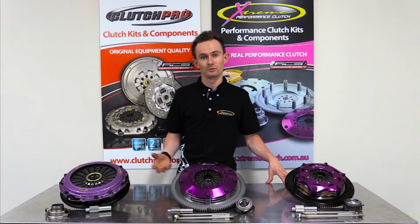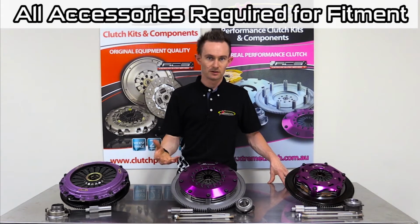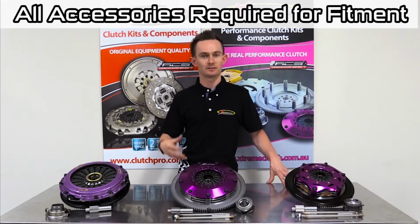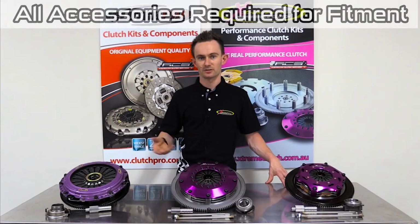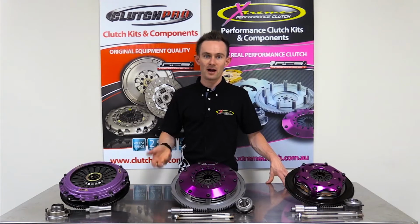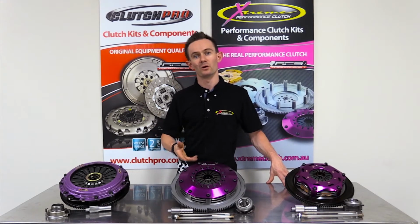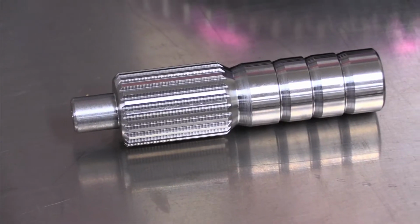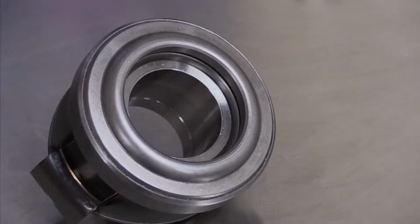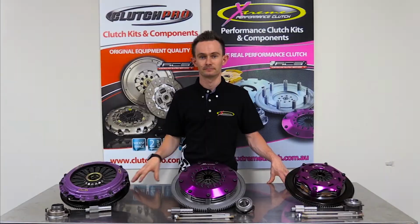All of our kits come with the required components to make sure that that kit can be fitted to a completely stock vehicle. So if it's a single plate organic kit stage 1, then it'll come with a pressure plate, a disc, an alignment tool and a pilot bearing when required. But if you buy a full motorsport clutch kit, it will more likely come with flywheel bolts, a steel alignment tool, release bearing and carrier, and all the conversion components if it's required to convert it to push type. It does depend on the level of kit to what components come with it.